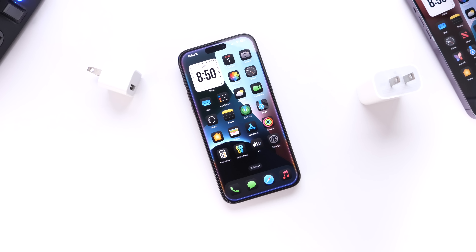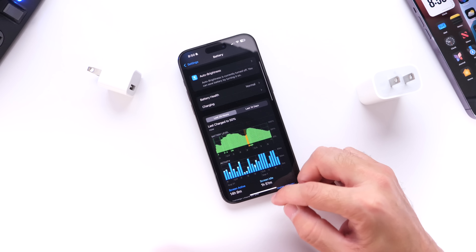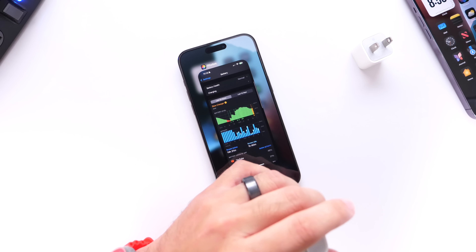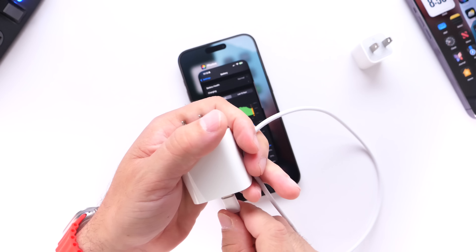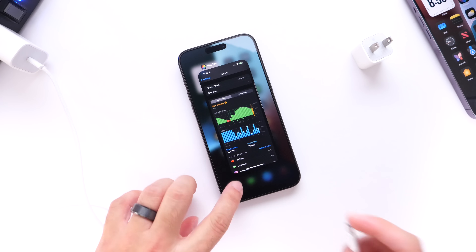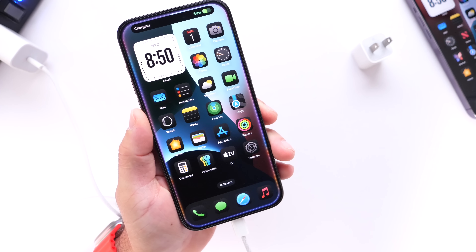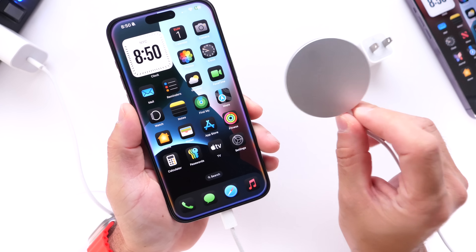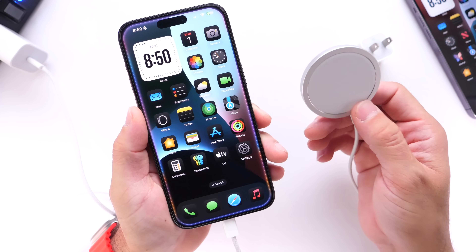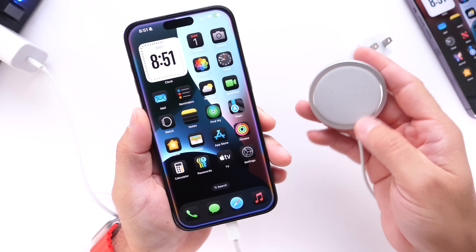Let's jump into the settings of this iPhone and make sure we're not charging. This also works with MagSafe chargers — if you buy a Qi 2 compatible wireless charger but you see those yellows on the meter, it means you actually have a slow wireless charger. If you have a MagSafe or Qi 2 compatible MagSafe, you shouldn't see those yellows. If you do, it means your MagSafe is a slow one and you may want to replace it.